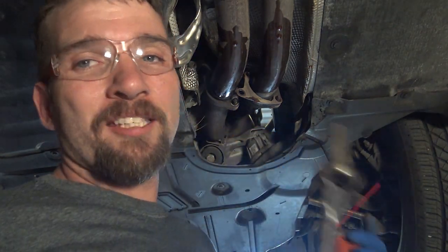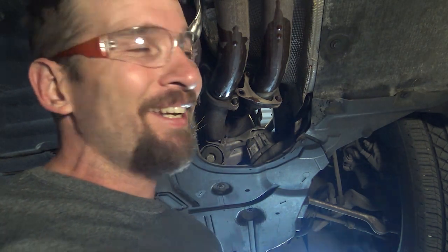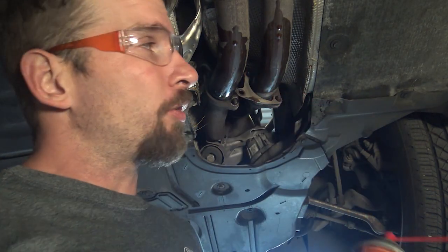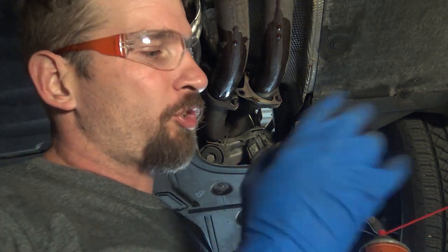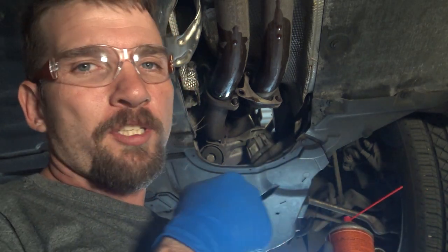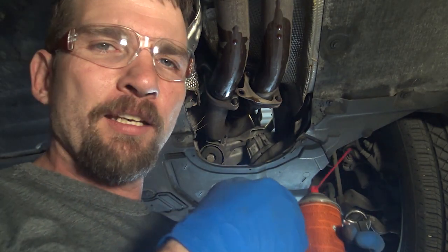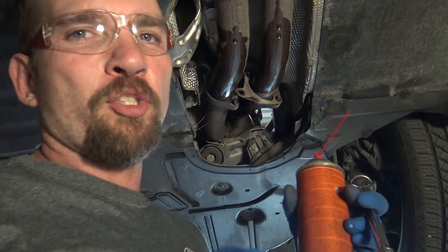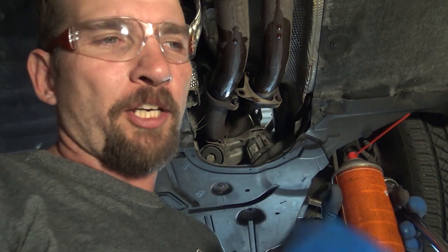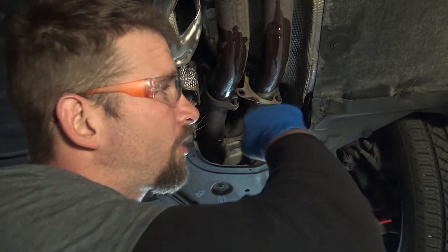That's the way I get off rusted nuts and rusted bolts — heat them up with a torch, get them as hot as you can, and spray them down with Knocker Loose. If you have an oxyacetylene torch, it works much better because you can get them cherry red and then put your ratchet on there. Try to loosen it; if you can't loosen it, tighten it. If you can't tighten it, work back and forth by hand. Once you start loosening and it stops, spray everything down with more penetrating lube, go the reverse direction, tighten it, spray it down again, and work it off. Also use a wire brush to help clean up the threads as you go, and most of the time you won't snap those off.